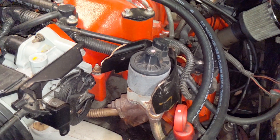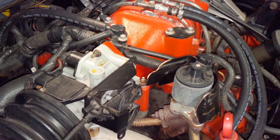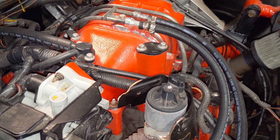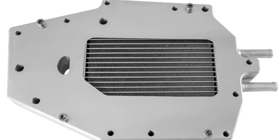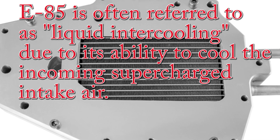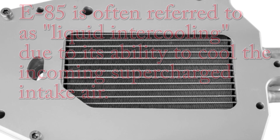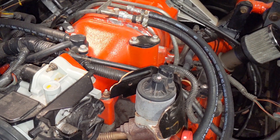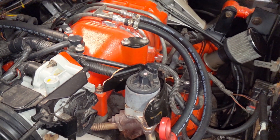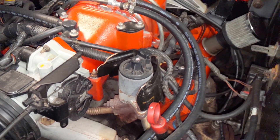The downside to the EGR valve is carbon buildup inside the intake track on the rotors. This engine has 160,000 miles on it and it has not been a problem — it's not pretty to look at, but there is a little coating. Now if you had an intercooler underneath the supercharger — I do not have an intercooler, to make that clear — if those fins are getting coated with carbon buildup, that could add restriction and insulate it so it doesn't transfer heat as well. So for intercooled applications I would probably get rid of this. But for my application, it increases fuel economy marginally and I don't have any downsides, so I've opted to keep it.